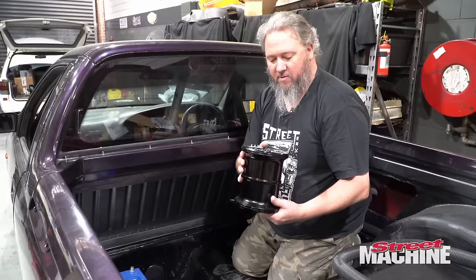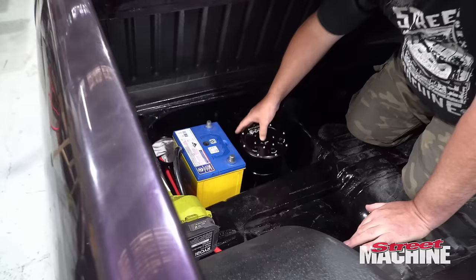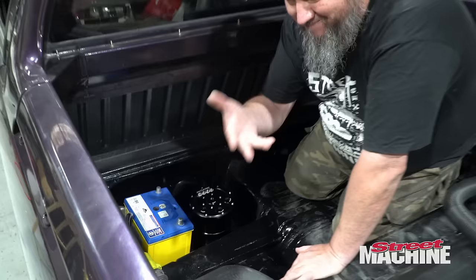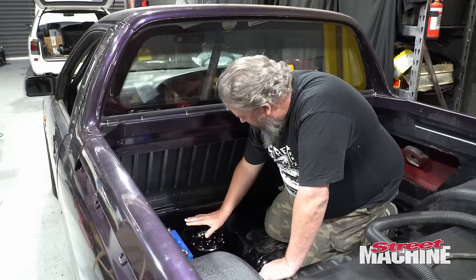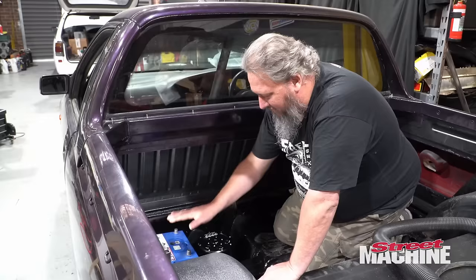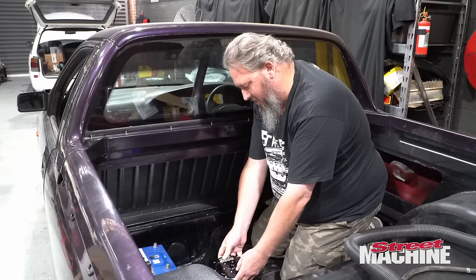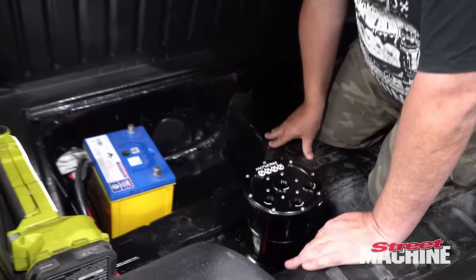Just like real estate, it's all about location, location, location. We need a location that's going to be close to the fuel tank, and it's not a million miles away from the battery. Some people will be unhappy with the battery being right close to the fuel system, but it'll be fine. We can mount it there — it's not going to interfere with the floor at all, plenty of room to run our hoses. We just have to work out the prime position. We can't mount it up here because it's too high; it has to be down here somewhere. I might have to flatten that floor a little bit.